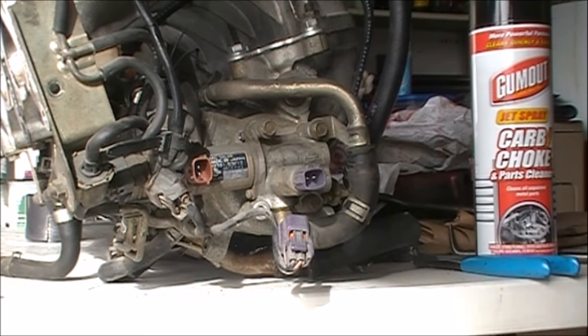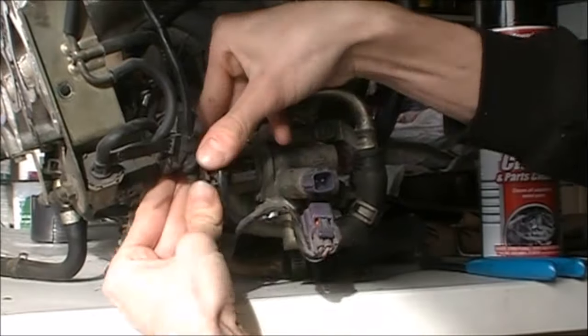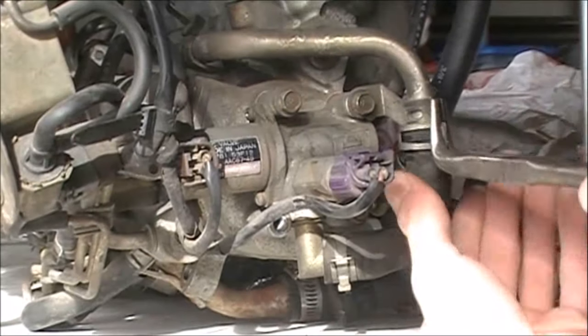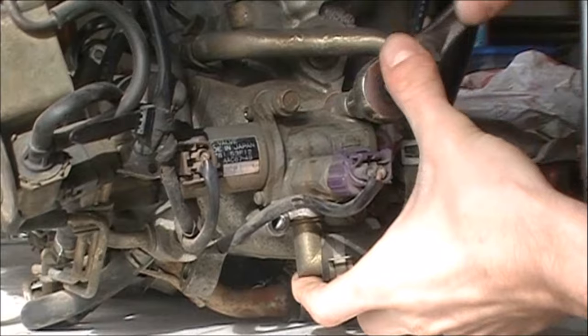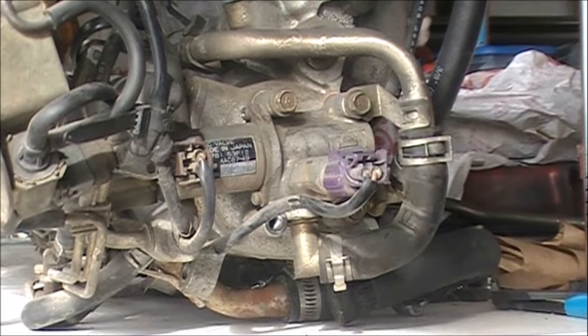You definitely don't want to put these on too tight — that's why I only did a few hits with the impact, and I have a really weak impact driver. We'll get the electrical connectors back on; make sure they click into place — on most vehicles anyway. Clamp back on the vacuum valve, tighten up our bolts — not too tight because it's an aluminum intake manifold — and we're done. Alright guys, that's all for this time. Your cleaned off idle air control valve should be back on, and you should be idling like a boss. Make sure to like and subscribe if you liked the video, and I'll see you next time.